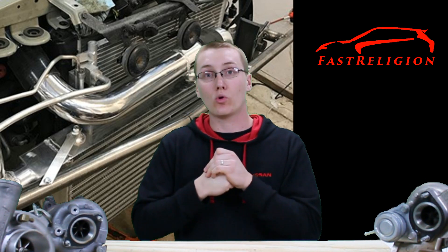Let's talk about intercooler size. If you're going to maintain a side-mount factory location intercooler on this car, there are a couple of aftermarket options out there. They're bigger, so they will flow more air. They're made out of better aluminum, so they will cool better. Is it better than stock? Yes. Is it the best setup to make horsepower on? No.